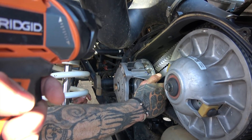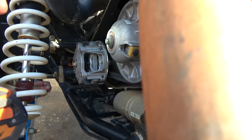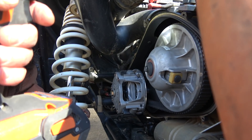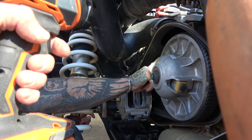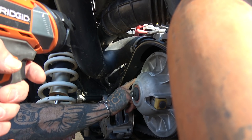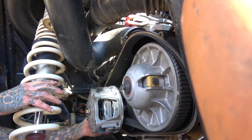It's got a little bit of groove on the inside, but it's good. It does you good to break it in correctly. There's a little bit of belt slap up there — that's my engine braking. The belt will slap up there, but it's not bad. Usually if it slaps really hard it'll rip the top of the belt off. It doesn't even look that dirty — maybe blow it out with an air hose.